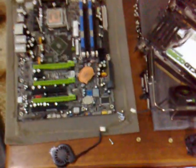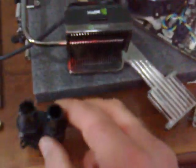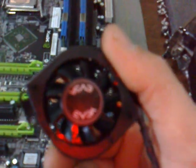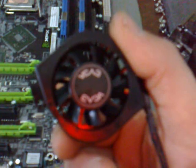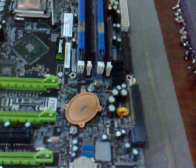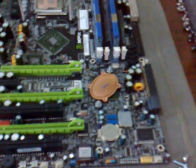What I'm going to be doing is using an old Swift Tech water block — I've taken that apart and I'm going to be using the copper out of that water block. As you can see it's on the MCP chip, and then I'm going to be putting on this fan. It's an old EVGA 680i MCP chip fan cooler, going on top of that. I imagine it will drop the temperatures a lot — at least 20 degrees cooler. I'm hoping anyway.